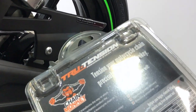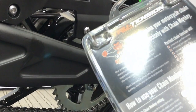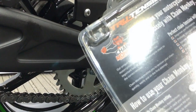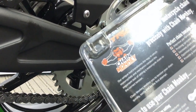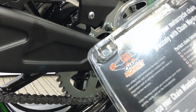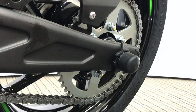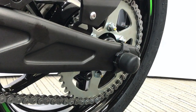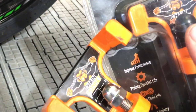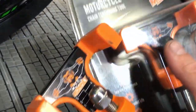Looking at the chart, we've got 25 to 38mm at setting 1.1 to 1.5, and 0.5 to 1 at setting 0. So setting 0 corresponds to 0.5 to 1 inch, and setting 1 corresponds to 1.1 to 1.5 inches. On this particular bike we're roughly between those two settings, so when we wind the tool up, going between 0 and 1 should be pretty much perfect. Pop the black cover off before you start using it — then it's really easy.